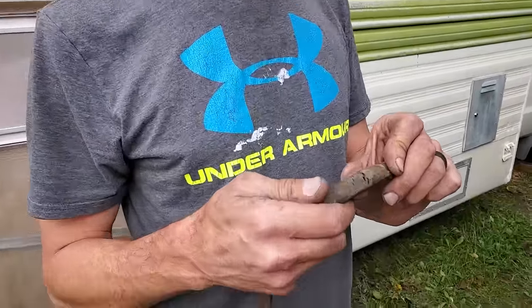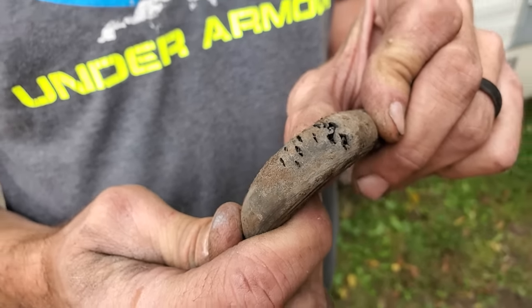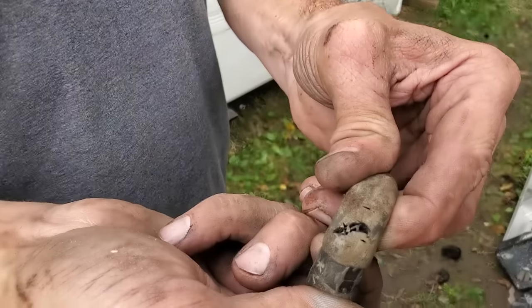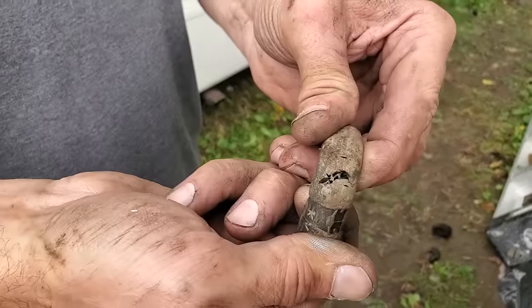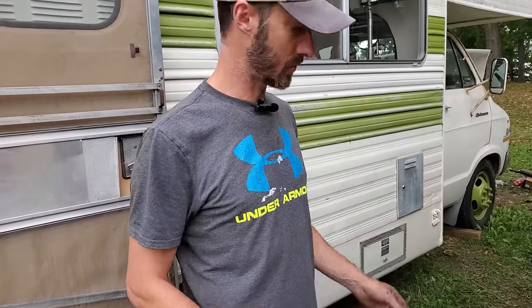So it's crunch time. We wanted to prevent any mishaps on the road, so I went ahead and replaced the fuel hose. You can see there's some cracks in that one on that end. And this is coming from the gas tank directly into the hard line. I noticed the last time I had the engine running, of course the fuel pump's going, and it's just dribbling gas out back there. So I replaced this fuel hose, replaced the fuel filter while I was at it. Hopefully everything else is good. The hard line seemed to be in good shape, so we got that done.